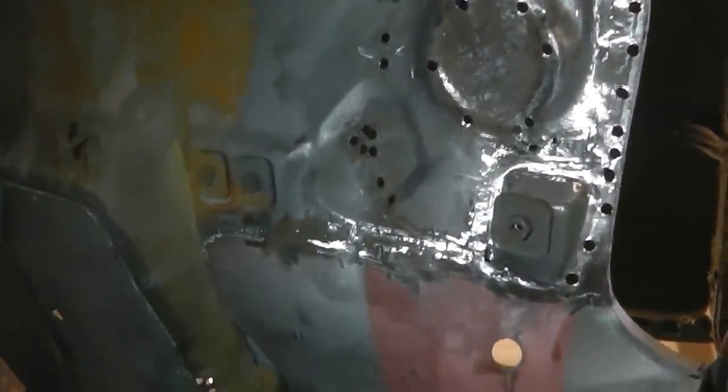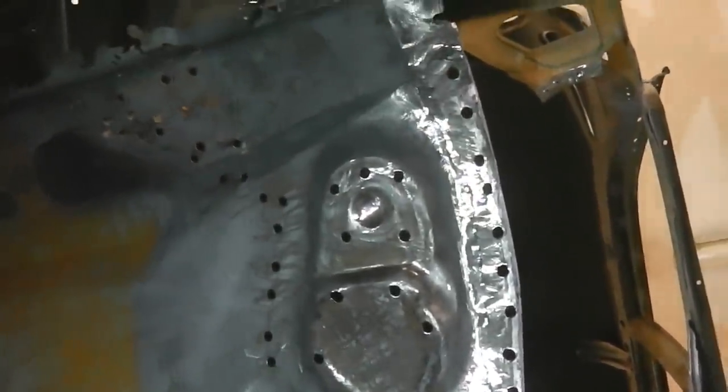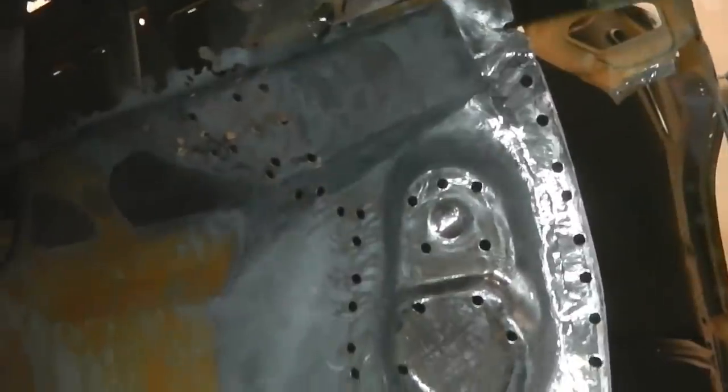There it is, great little tool from Machine Mart. It's LED, so it doesn't get too hot and you don't burn yourself. It's pretty good. So we can overspray this now with weld through primer. There's no point making this the body colour brown, the Ford brown, because it's going to burn when I come to weld it, and it's going to end up with burnt paint inside that. You may as well just do the one layer.